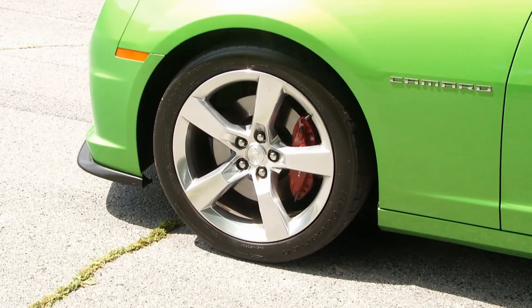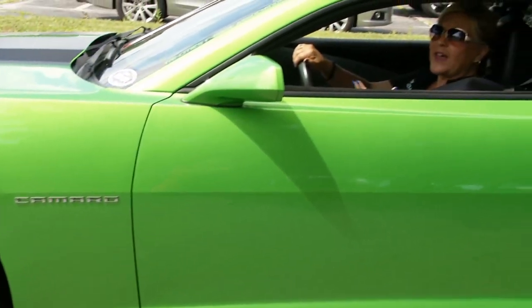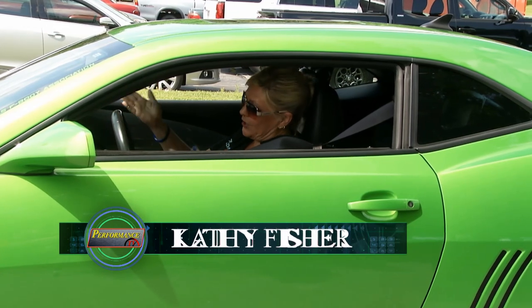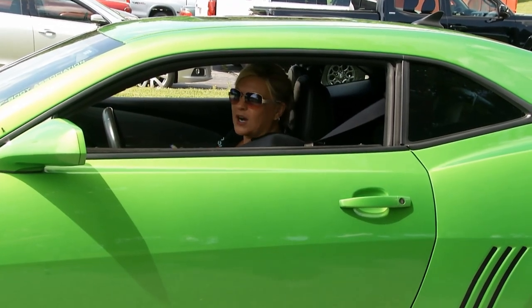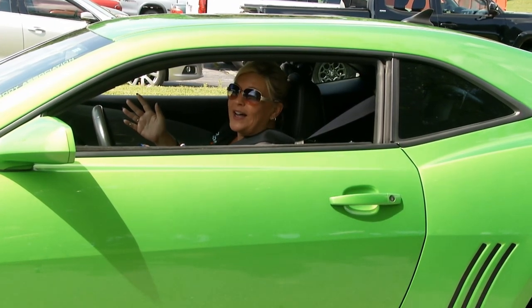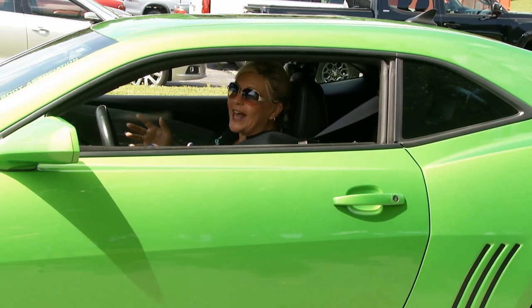Welcome back to Performance TV presented by Top Coat. Back in 2008, automakers went to a drive-by-wire system. What that did, in hopes for them, was to save parts and get a better connection right to the throttle body. But what they really did was take away some of the fun — they took away throttle response and deliberately put in a throttle lag.